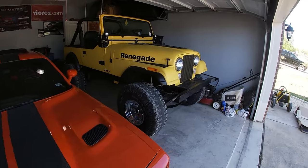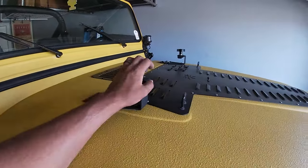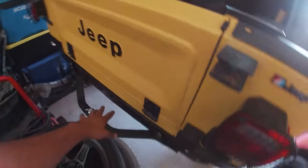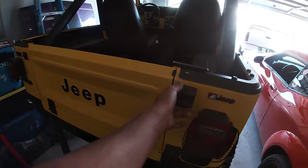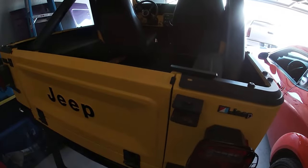But yeah, so next step on the Jeep is what I'm about to do now, put the high lift jack back on here. I took it off just to tow it. And when it comes to the spare tire carrier, right now there's nothing in the back of the Jeep. I want to get a bumper that actually holds the spare tire versus it leaning up against the factory tire carrier, because the 35 is so heavy that it starts flexing the body, and I don't like that.